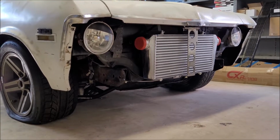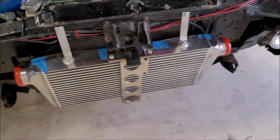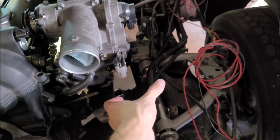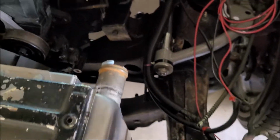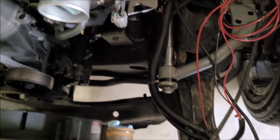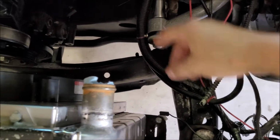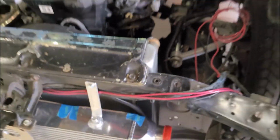That's pretty sweet. Next step, I think, is probably doing the intercooler piping since the intercooler will be in its final spot right here. It's going to come over at an angle this way right off the 90. The 90 is going to angle down a little bit to meet with this guy. This is basically going to be 90 right out of the end tank, right through the core support, and then 90 right off here, and then it'll just be an L between them. So it's going to be one big Z that's kinked at an angle. So nothing too crazy there.